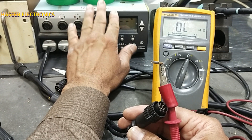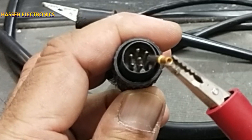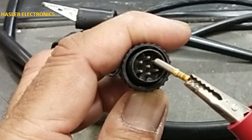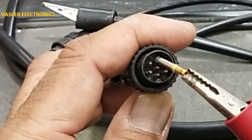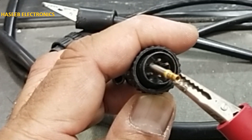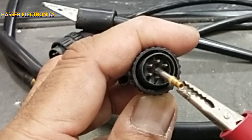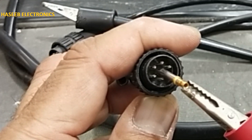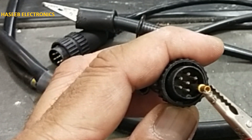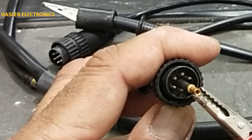The controller — this time I'm not going to open my device because it is functional. These two pins give approximately 6.2 to 7 ohms for the heater. The next two pins are the sensor for the temperature. This pin and the center pin is the vacuum switch. From here to here is the heater; from here to here is the sensor.